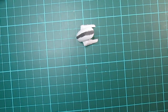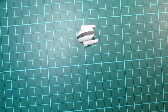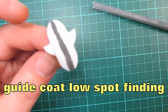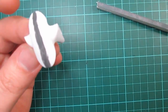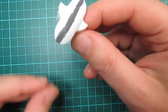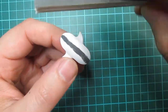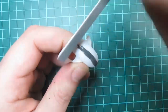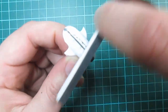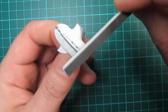So, those of you familiar with the automotive paint industry, incredibly talented Mr. Fox will be jumping in at this point saying, "Ooh, I know what he's doing here." You can't remember the name of the technique right now. I'll flash it on the screen at the moment. Basically, they use this in repairing your paintwork on your car. If you've got a dink or a dent or anything like that that needs smoothing out, they'll overspray with a contrast colour. In this case I've got grey on white. And then let's go in with a smooth grit first, just to show you. It'll reveal a high spot and a low spot. It helps you figure out where you need to do some more work to get yourself sorted out.